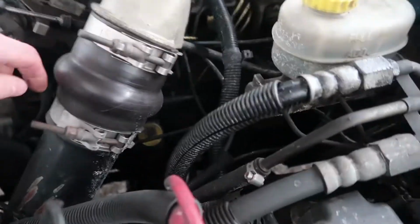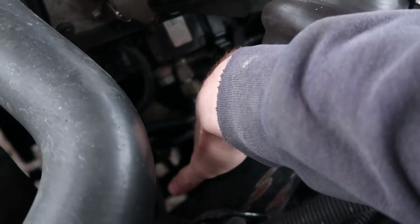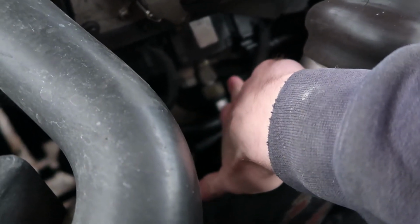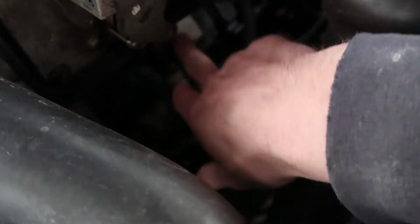But C, there's still a line that comes off of the bottom of the fuel filter housing and then runs up here to the bottom, or into your VP44, and that is your feed line right there to the VP44. As you can see, come on camera, focus for me, boy. As you can see right here, this is my BD low fuel pressure warning light kit right there, and that's going into the banjo bolt for the feed line on the VP44.